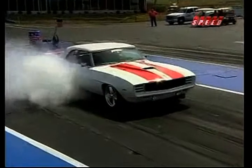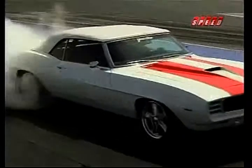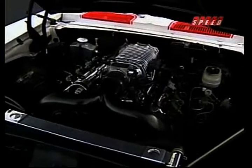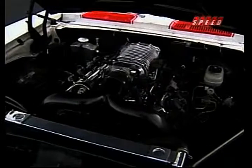Superchargers like on this particular car, we can basically put on a stock bottom end and not feel too bad about it. However, if we wanted to make a lot more boost, or if we were going to turbocharge the car heavily, something like that, then we really need to go through the bottom end, to make sure all the things in the bottom of the engine are going to be able to withstand all that power that you're going to make by force-inducing air and fuel to it.